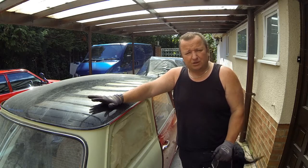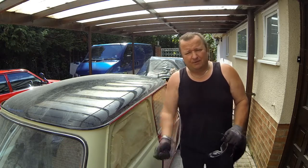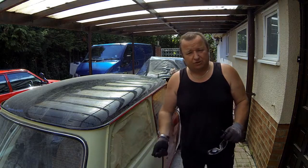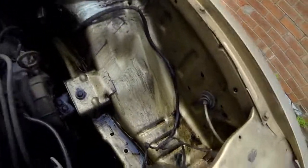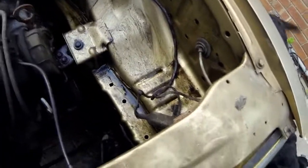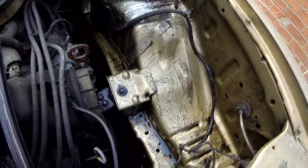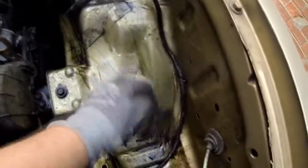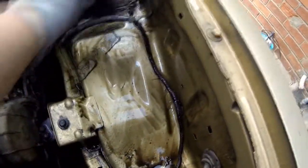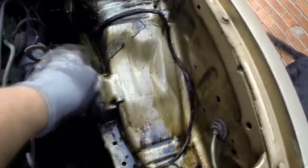So that's what we hope to be doing. I'm just working on the engine bay at the moment of the Triumph and I'm giving it a bit of a cleanup with a bit of a white spirit solution. As you can probably see, it's actually cleaning up pretty well. I've just agitated it - this was all covered in heavy grease, as you probably remember - and I've just put some solution of white spirit and given it a wash over like this.